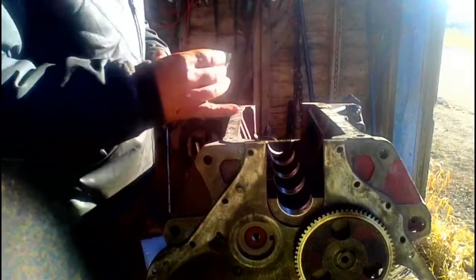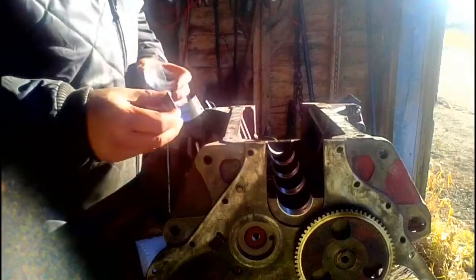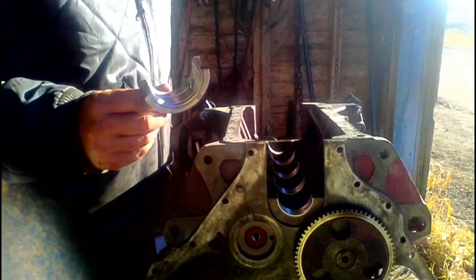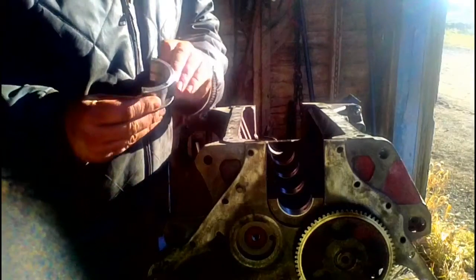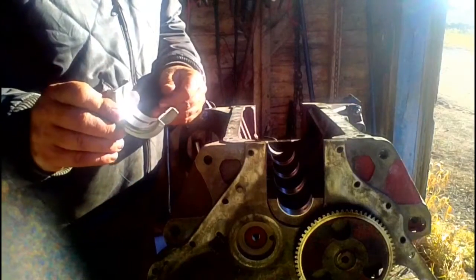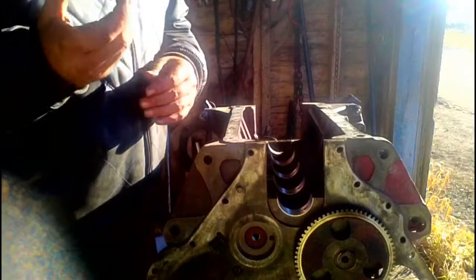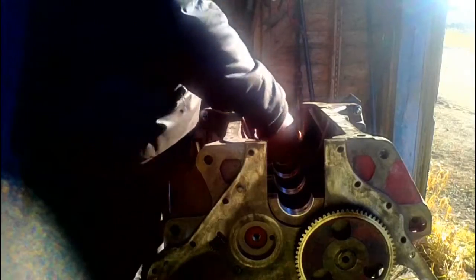The bearings that go in the block have the oil hole; the ones for the caps have no oil hole — put those aside for the cap. The rear main bearing is a flanged bearing with a flange on each side because it is the thrust bearing for the crank. I like this setup a lot better than some that have separate little washers, because those can drop out pretty easily. This solid one-piece design means you don't have to worry about losing your thrust bearings, and it fits in exactly the same way as the others.